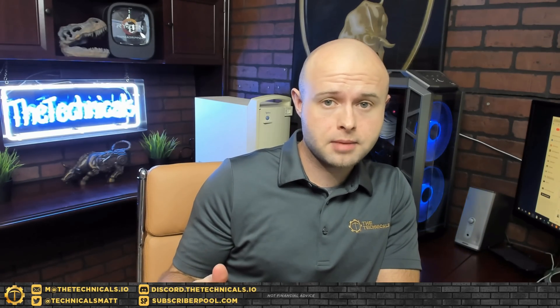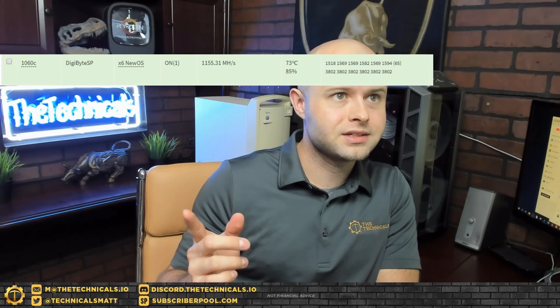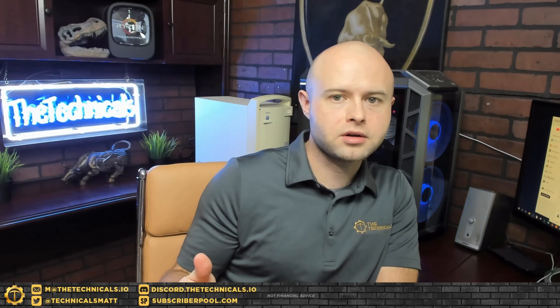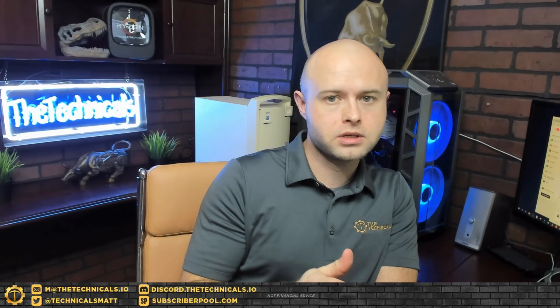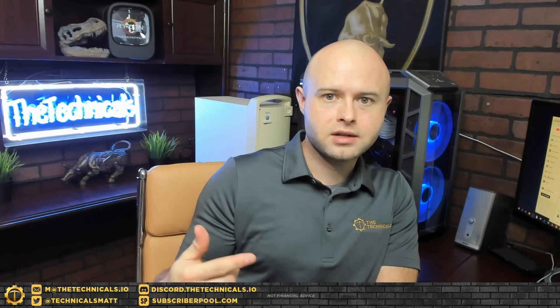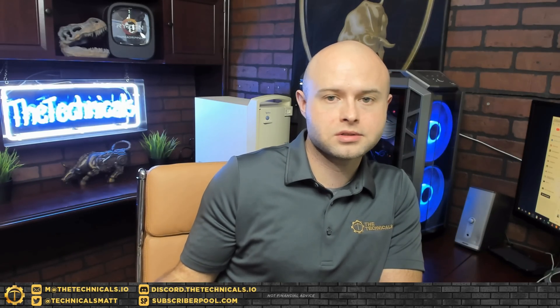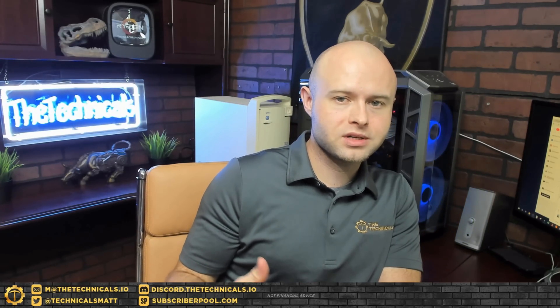That's it — pretty underwhelming. I had higher hopes for this and thought I'd achieve much lower temperatures. The rig is still operating right now without issue. Looking at the Simple Mining dashboard currently, it's showing 1060 at 73 degrees Celsius — the hottest part of the day, about 5pm on the East Coast. By comparison, all the other rigs are running in the high 60s or mid 60s depending on the rig. For this rig, considering it has no fans and those star-configuration heat sinks, I consider that pretty good. On top of that, fewer moving parts means a failed fan won't spike temperatures — though a case fan failure could still bring multiple cards down.